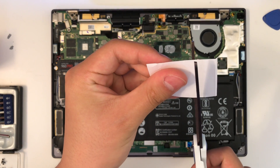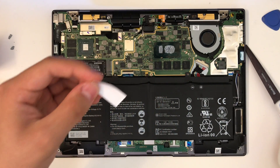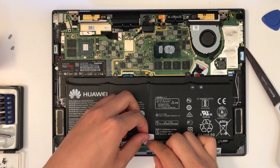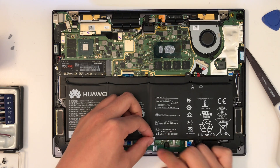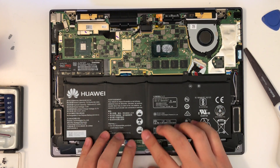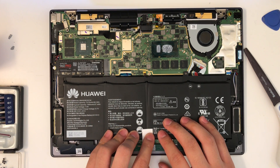I'm going to take a piece of paper and stuff it in here. You don't even need to remove the battery or the touchpad itself. Just slide it in. There's a little bit of empty space, and the point of this is to fill that little gap so that it doesn't rattle loose like that.